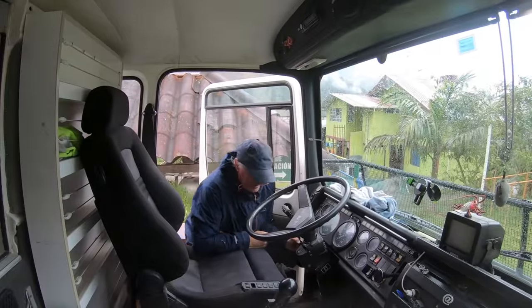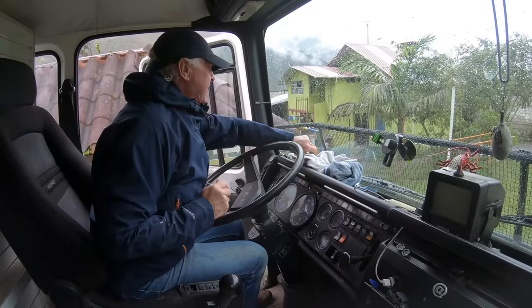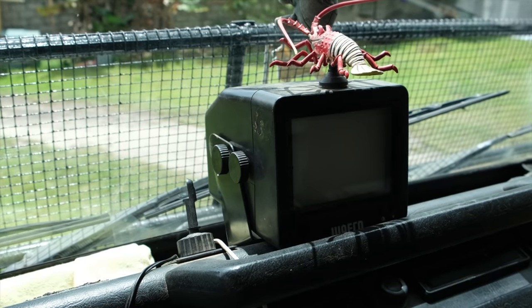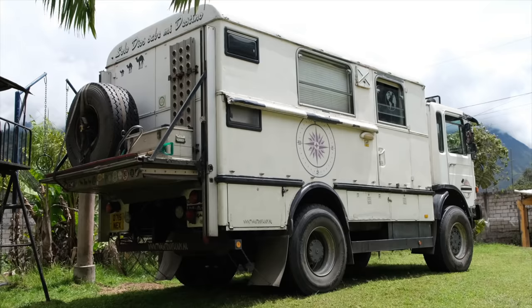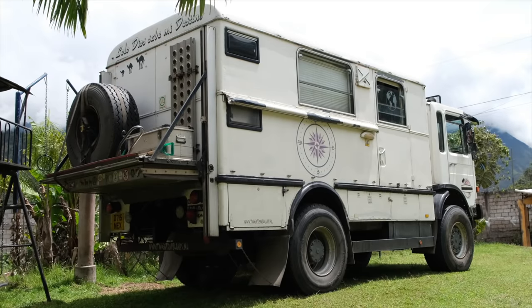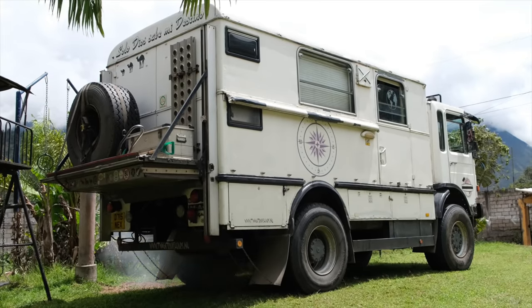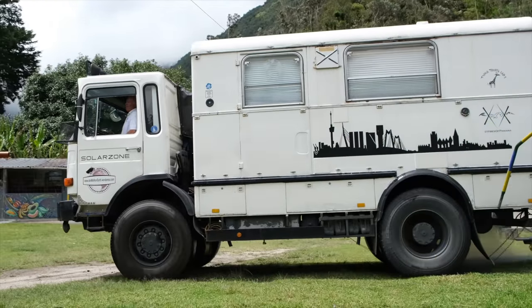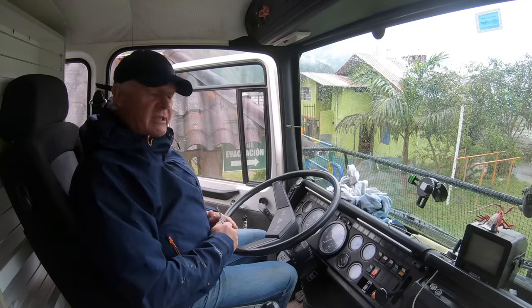I always isolate my battery, so then I'll switch the batteries on. All the truck's live now. I've got a kill switch here, and then I have another little hidden kill switch. So I switch on the TV — I've got a reversing camera — with a key. With diesels, you have heater plugs, so you let those heat up. When it's ready, you start the engine. I wait for the air pressure to build, let the brake off, and I'm ready to go. It just makes it very hard for anyone getting in the truck — they've got to know the whole system to start it.